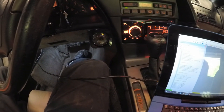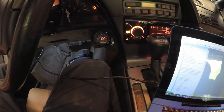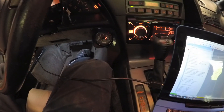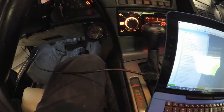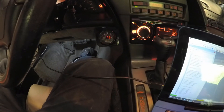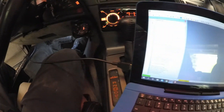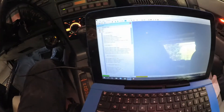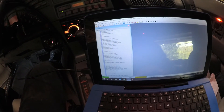Okay, we're up and running. I'll let it warm up. Because this is the second take, I already kind of have the volumetric efficiency table already logged in close to where it should be. So to give you a quick example — engine speed versus idle speed versus temperature — hopefully you guys can see this.